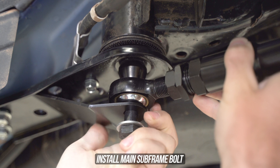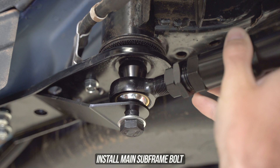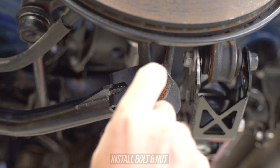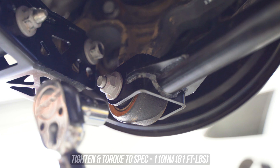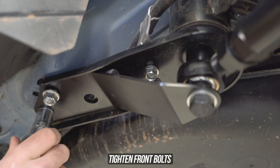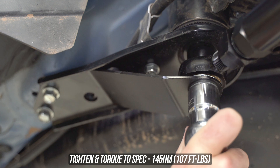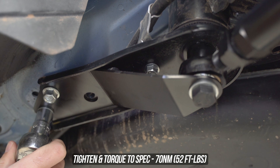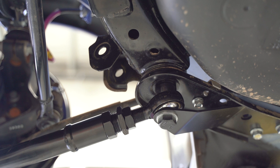Remember to fit the correct side so that the arm bends down to clear the subframe and out to clear the wheel. Get the supplied hardware and throw it up through the double shear mount, winding the nut snugly into the threads. Scoot over to the knuckle side and throw the OEM bolt through one side, then wind the nut on the other. With everything fitted up, torque it down to the specs shown on screen. Head up to the two mounting bolts on the subframe bracket — being as we left these only hand tight — tighten them down properly, and leave the subframe bolt until last, torquing that down to the specs shown on screen as well. Now let's address the big metal elephant in the room: you're not actually bolting the traction arm to the same mount as OEM.